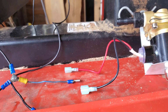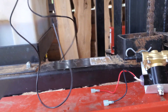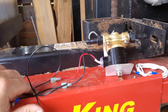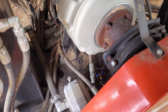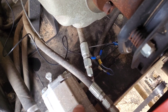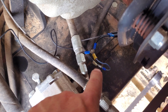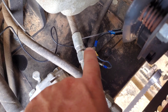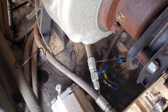Let's go ahead and hook it up and show the routing. This section here is about three feet — all I need is to go from the clutch to where I'm going to mount the solenoid. As you can see, we've made our connection: coming from the clutch switch, plugs in male to female, goes through, then plugs into the actual clutch itself. And our tag line will go down below to where the solenoid is.